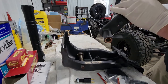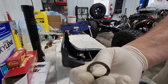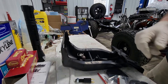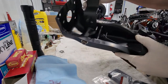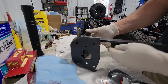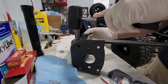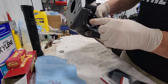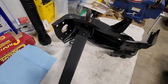When I was test fitting the bushings with the pedals it's definitely snug, so I'll have to tap this in with the rubber mallet. There's a wave washer that goes on the very end before it hits the side, and then it's just a washer and a stover nut on the outside. I ended up laying it on its side, lined up the key, and tapped it all the way in. Once I got past that point I was able to put the wave washer in, and now everything moves. Going to go ahead and snug this nut up.